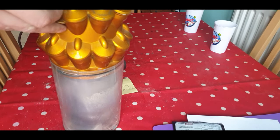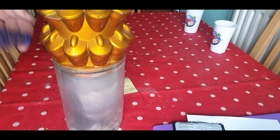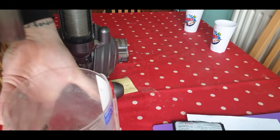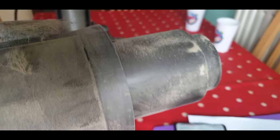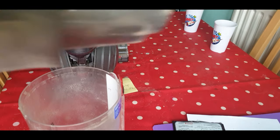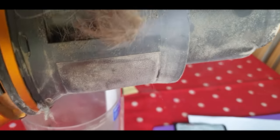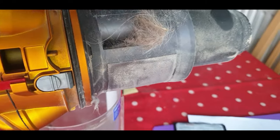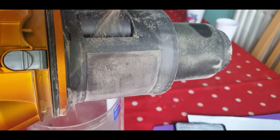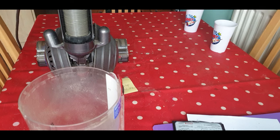The filter seems to be fine. I'm just removing this from the bottom to check the seals and the filter cartridge — to make sure it's not completely clogged. There's a lot of garbage there. I've taken this out and where this dog hair is — this hole was completely and utterly rammed full of hair and dirt and rubbish. So I'm doing my best to get it out and give it a good clean, then put it back together.